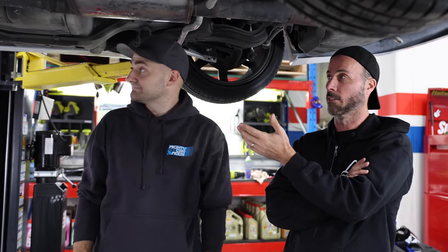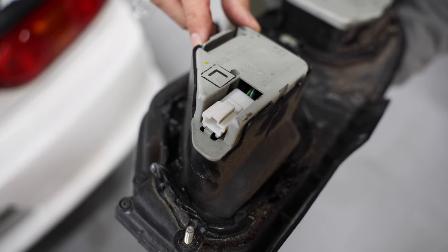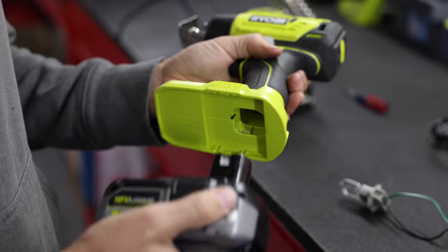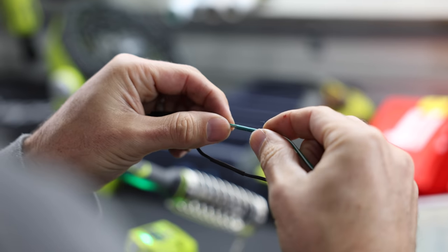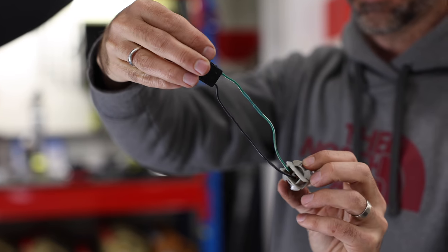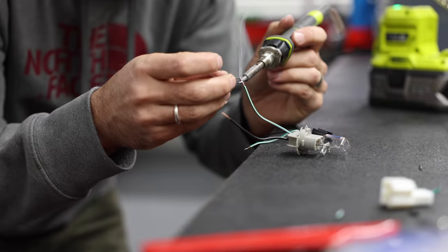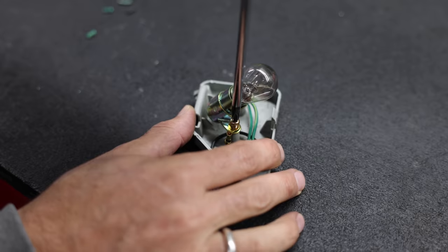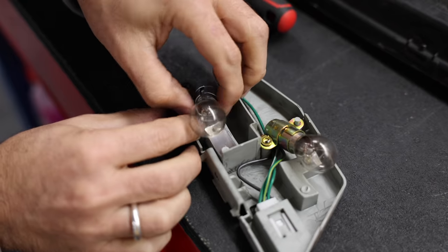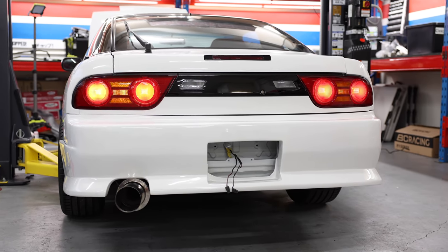Once the car's working, we also have to get it made legal for street use because it's been unregistered for so long. This involves an authorized inspection to make sure that it's safe, it meets design and safety standards, and a check for tires, body condition, working lights, indicators, horn and dash, engine leaks, seatbelts, and a brake efficiency test. Only then can we get number plates, insurance, and registration. Because I've updated the rear lights, they no longer work with the factory loom plugs, so I need to re-solder old-style plugs onto the new lights. This is fairly simple because even though the updated lights are a new design, most of the wire colors have stayed the same, so it's just a matter of mixing and matching. And with that done, the lights and indicators are now all working.